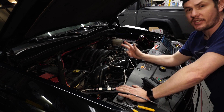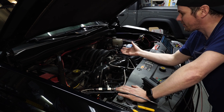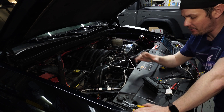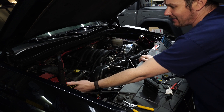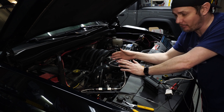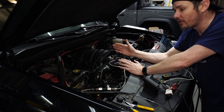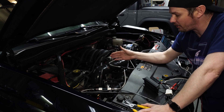We need two things in order to do that: a manifold pressure signal so we can see the pressure, and then RPM. I've messed with this for about the last hour and a half trying to get my RPM to read correctly without tying into my cam sensor. I literally have it tied in off the signal from my number two coil that I use for my snow performance methanol injection kit. That kit works perfectly fine because you can adjust the multiplier. I dug around forever and could not figure out a place to adjust the multiplier for our crank input on this.